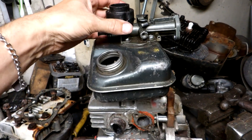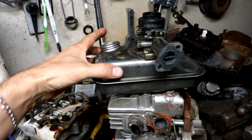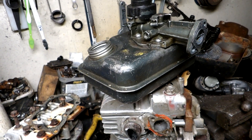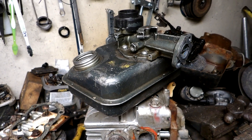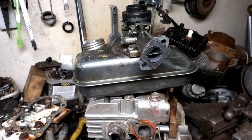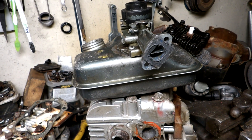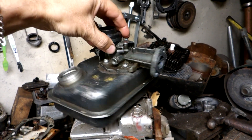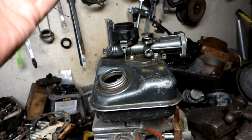Here's basically a two-horse Briggs carburetor. I tried to mount the deeper gas tank and carburetor off of a three-horse Briggs on it. I got it all mounted up but my son tried running it and it just wouldn't run worth beans. I even made a small plate with a small hole in it. He said it worked better with that, but basically on the two-horse Briggs it's only a six cubic inch engine and you have to run this original carburetor on it — at least if you're running a Briggs carb.